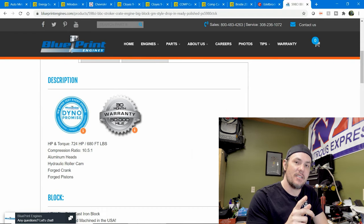Last but not least, we're running the Edelbrock ProFlow XT intake — kind of like the old TPI injection intakes but running a 102mm throttle body. We're going fuel-injected since we've already been working on the fuel injection setup. I managed to snag one off eBay for about $75 less than retail. These are not in stock anywhere — the bare ones and the black ones. I really wanted a black one, but I'm not going to wait until January or February for the intake manifold. Everything's rectangle port on this setup, so whenever I had the chance to snag one, I snagged it. You have to buy the fuel rails separately at about $150.